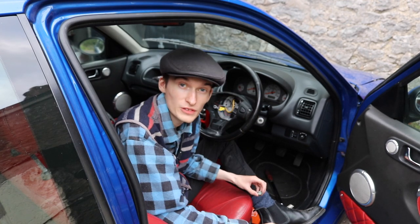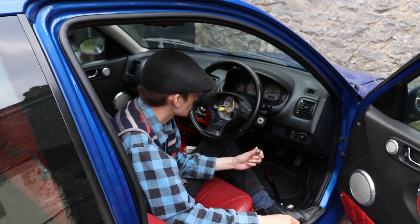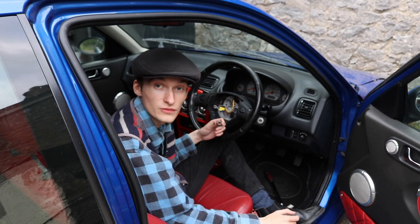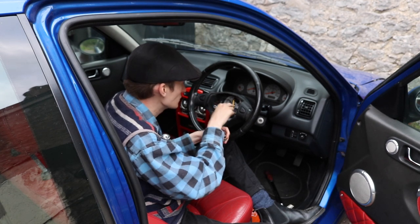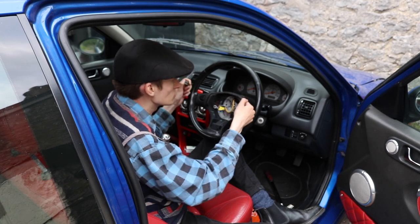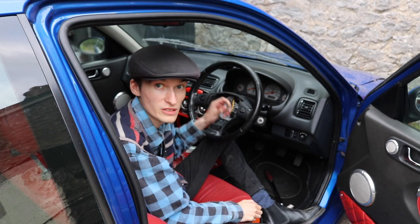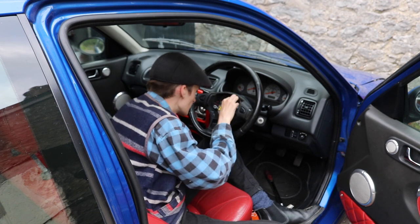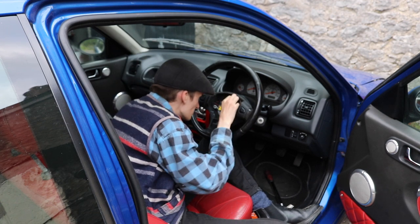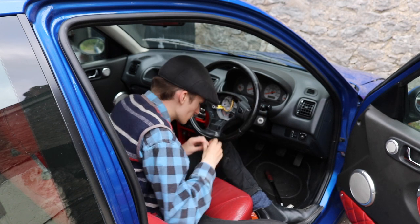And the other thing you need to do with steering wheels is, when you take your nut off, you mark on your spline and on your steering wheel where it is, so when you put it back on, it's straight. But we're swapping wheels, and the wheels are straight on the outside, so we should be all right. Now I'm just thinking, I think there's another connector there, but I can't remember. I don't think it needs to do that, so we'll be all right.